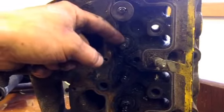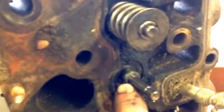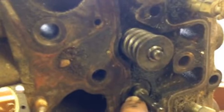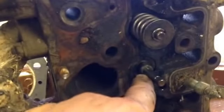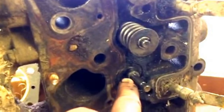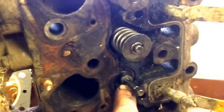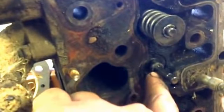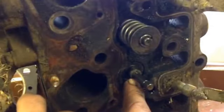This guide here is just a pressed fit into the head. Because it's such a nice shape, you can tap them out from below — get a socket or a bar and tap them out because they've got a nice tapered end. It doesn't matter if you smush them over a bit; tap them out from below and tap a new one back in. How deep it goes in isn't as crucial as you'd think — you can get your valve guides in wrong by half a mill to a mill without causing any issue.